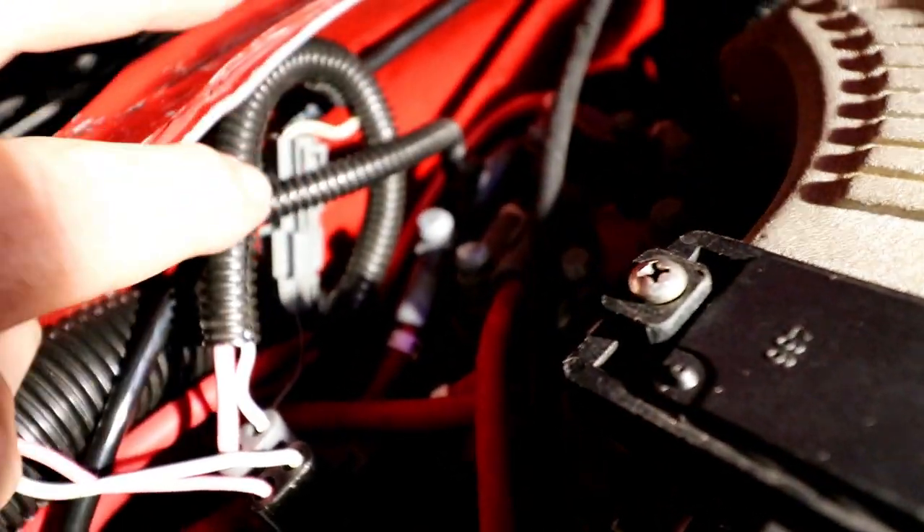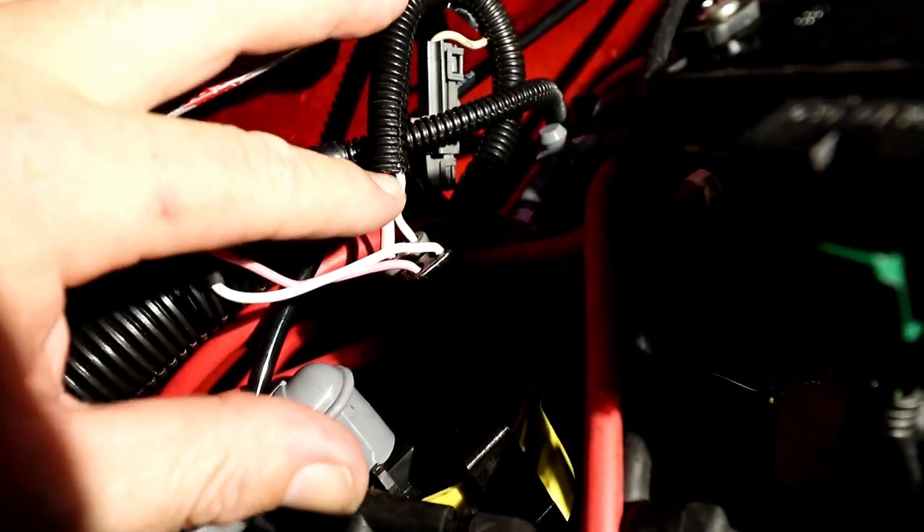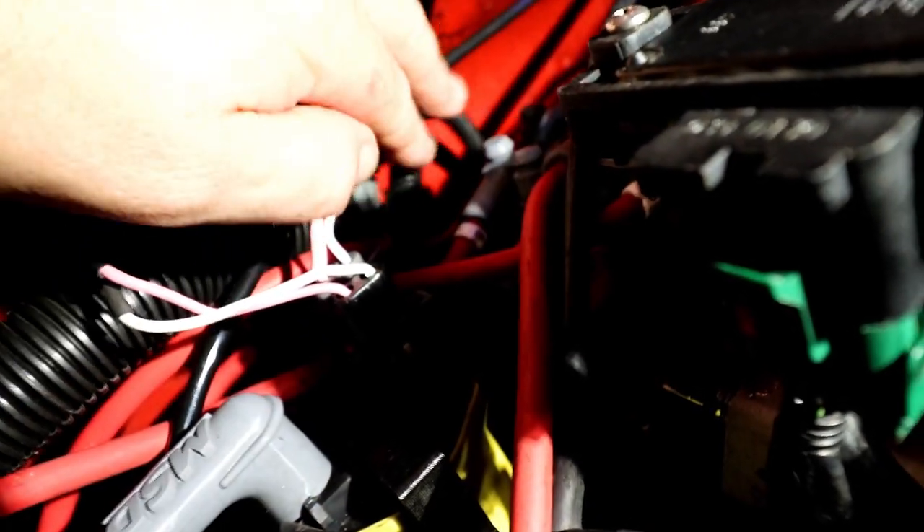Here's the new plug — you can see here the way it's kind of forced to bend over a little bit to clear the hood. Any break right there is kind of bad. And here's the second plug — you can see right here the solder and heat shrink I did a while back to replace this one. So power comes into here, and it's a good possibility that if I was losing power through here it could affect power to the EST. But I think we're good right now.